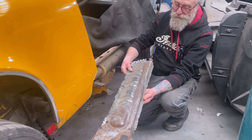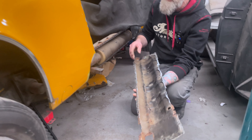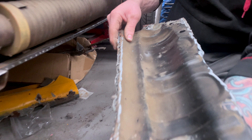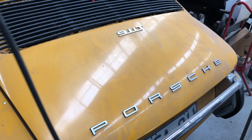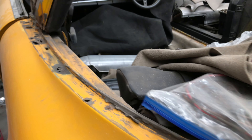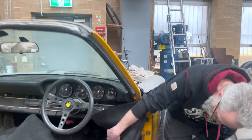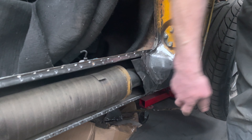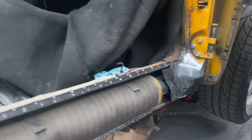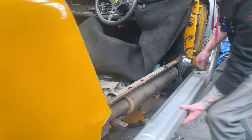Is it an Australian car? It is a right-hand drive car. Is that common on a Porsche of this vintage to suffer that kind of rot? Not really — I don't know if it's an English-delivered one, but it doesn't seem to have gone past in here. Everything we took off the car, we've got new panels to go on. But the panels we took off just seem to be rusty between the outer and the inner. So the ears here are all starting to rot out between the two layers. The outer was rusty too, but on the inside it's nice and clean — he's been lucky in that respect.